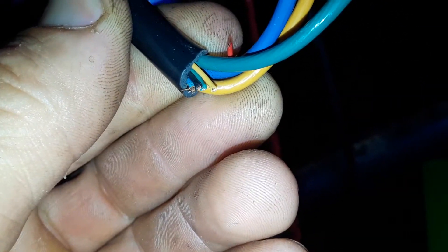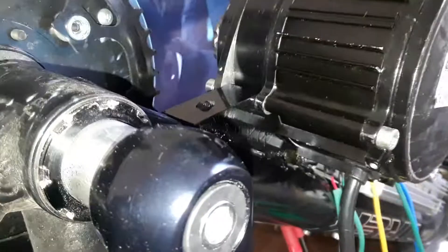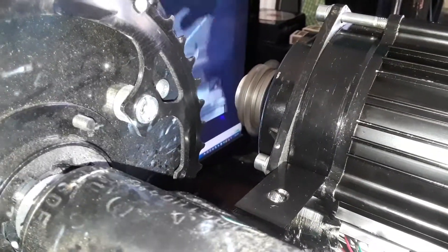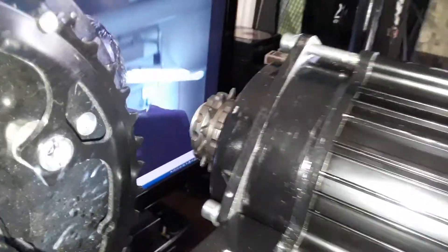Over in the backside, it's not running on Hall effect sensors — you can see those are cut. So Hall effect sensors are cut, just phase wires. I had to reverse the green and blue to get it to go the right direction with this controller, but it's hooked up and I'm soon going to have a mid drive.